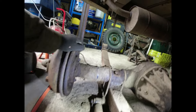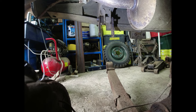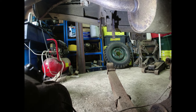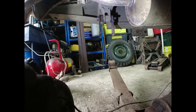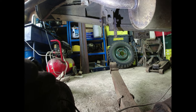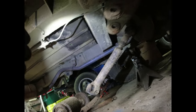Oh dear. The other thing is, the top bolts on the shackles up there are absolutely seized in solid. Cannot move the things. I've had Mr. Dugger Dugger going on them and he will not move. So I'm just going to spray with lube. Worst case scenario is that those shackles stay on the car. I suppose I could chop the threaded end off with a reciprocating saw, and then bang the bolt out. But I don't want to be bending stuff, but it needs doing properly.